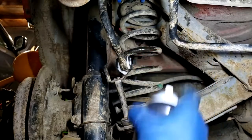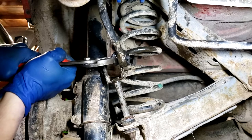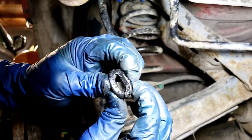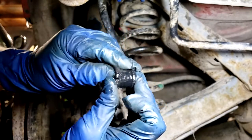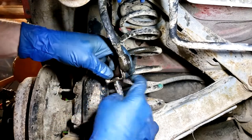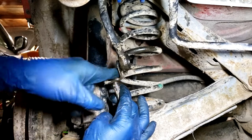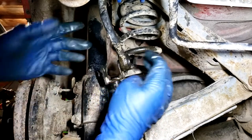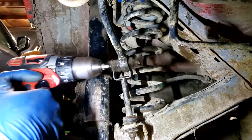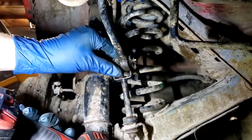This factory one is definitely old, brittle, and cracked. Now, same as with all these bushings, I'm going to clean up inside this bore really well - clean up any dirt, sand, anything that's in here - and then we'll lube up the new bushings and get those in there. Oh - it just broke.